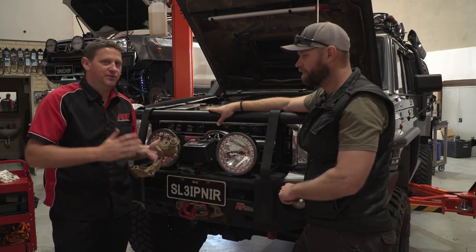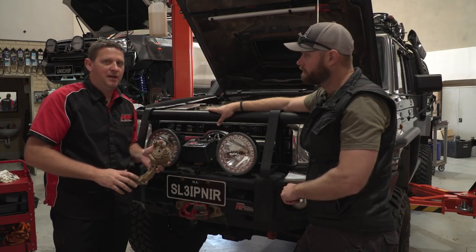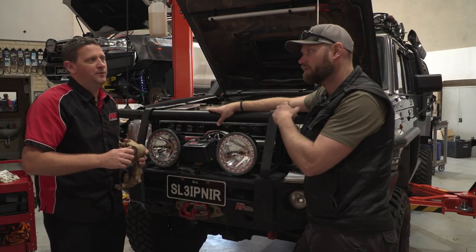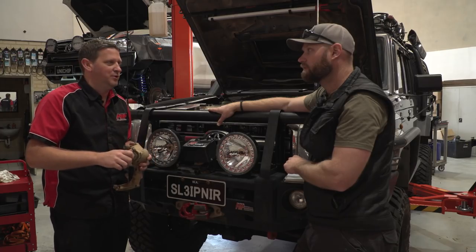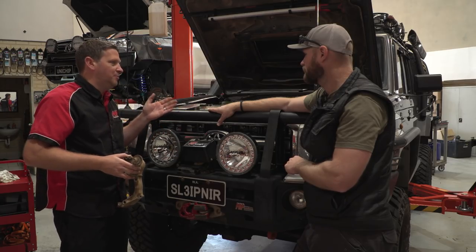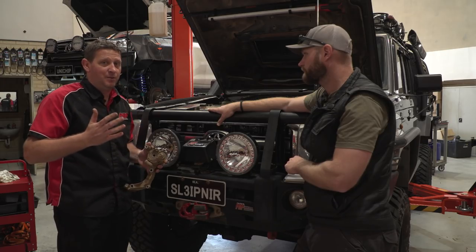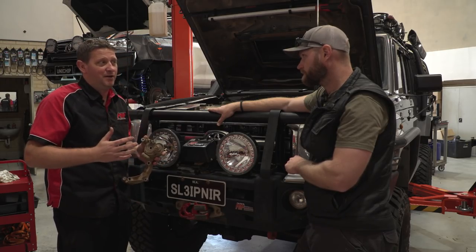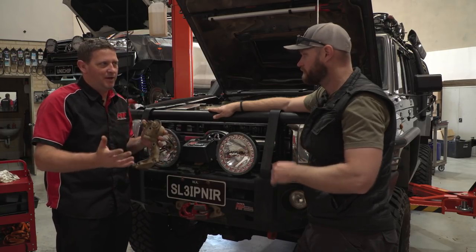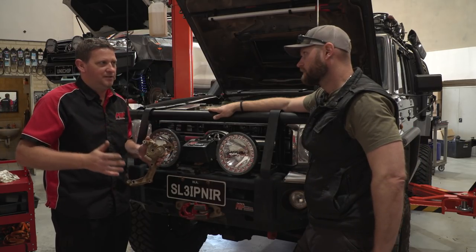So that's in the car now with the new pulleys and the tensioner. The water pump is in, the radiator is in, the hoses are in. We've also drained the block and drained the cooling system completely. We're running Toyota Long Life Coolant, which is rated for 150,000 kms as well. It's a super long life coolant, and it's a pre-mix, so we just put the straight Toyota coolant in. We do see some customers who've had their radiator done and gone for an aftermarket coolant, and I actually believe that causes more problems than running the manufacturer's coolant — because you're contaminating two different coolants. I would always say use genuine OEM coolant.